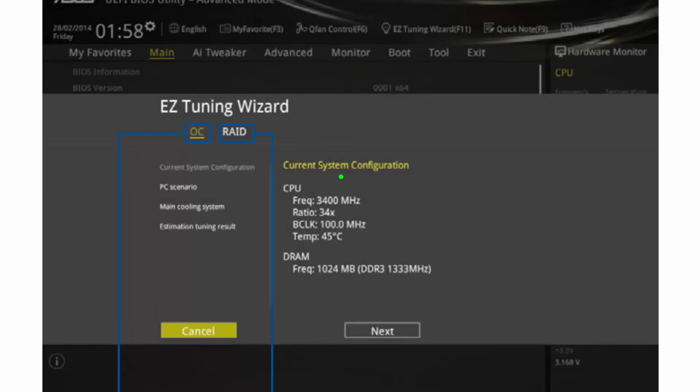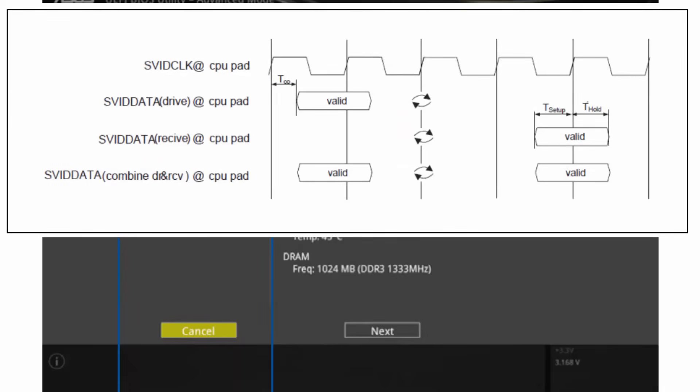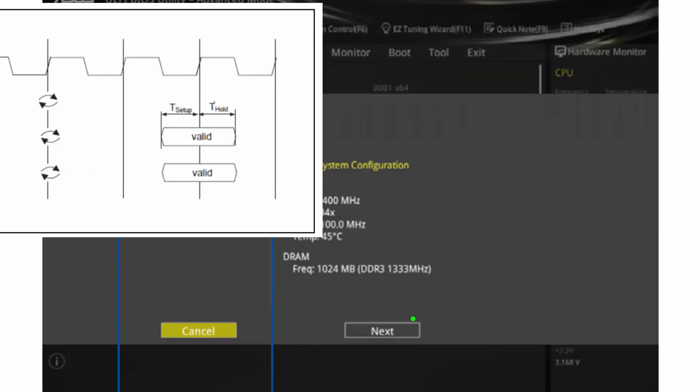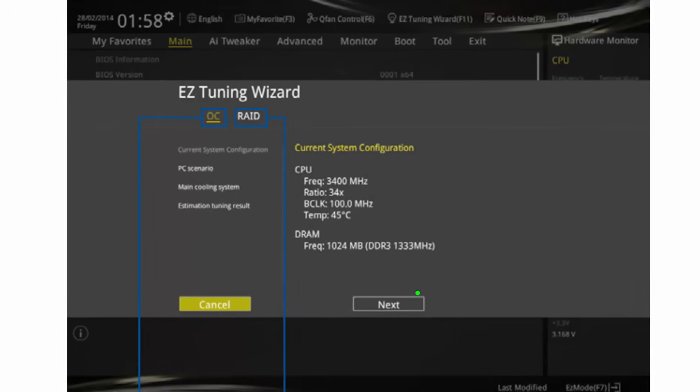Some firmware allows the tuning of timing for your RAM, CPU, and chipsets. Generally, unless you know what you're doing, stay away from that — leave it at stock clocking and timing. If you get in there without knowing what you're doing, you can actually cause the motherboard not to boot. Be cautious: if you know what you're doing, fine; if you don't, you can get yourself in trouble quickly.